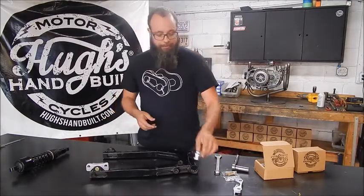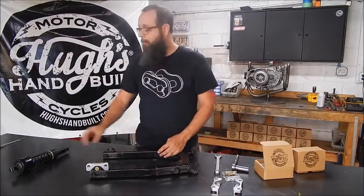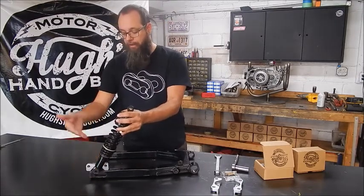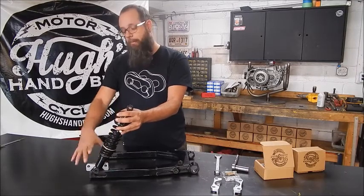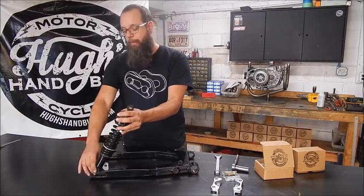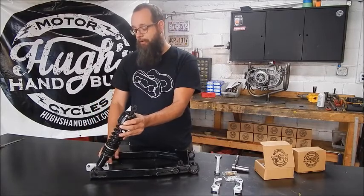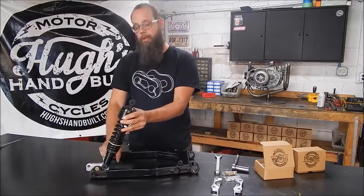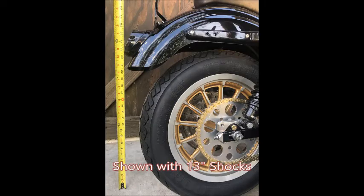So what does that do for you? You're going to put one on each side of your swing arm — this particular swing arm we've just bolted one on for show. Let's talk about attitude. Your factory bike will have the shock mounted in the middle mount on this. If you want to retain that middle mount, just use your stock hardware and bolt it on there, no problem. But say you want to go for the tracker look, or you're looking for the hooligan bikes that are racing now — give that bike a little more lift. Move your shock to the forward location, using your factory hardware or the hardware supplied with your aftermarket shocks. That'll give you about an inch of lift if you use the forward location on your swing arm mount.